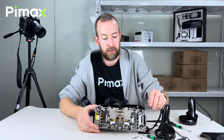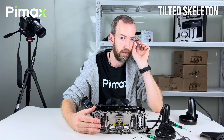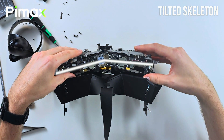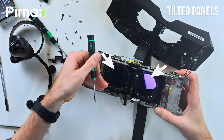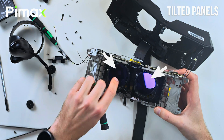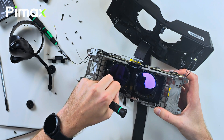One thing to note about the exoskeleton is that it's slightly tilted in typical Pimax fashion. That's because the human eye sees more field of view on the outside rather than the inside, so by tilting them we increase the FOV. The tilted panel inside actually has two purposes: one is to keep dirt away from the QLED panel — you can just clean these if you want — and the other purpose is to reflect the infrared lights coming from your eyes into the Tobii eye tracking sensor.